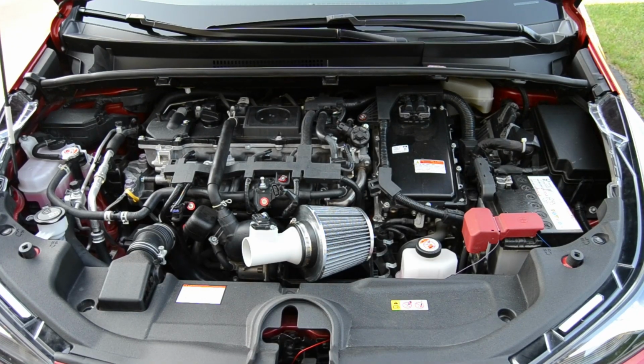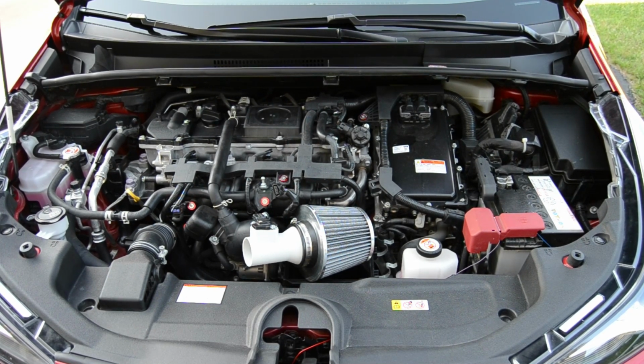Now if you are doing a full-on cold air intake or you're doing a different size of filter, also linked in the description, it's the exact same link, I will have a different version of this MAF sensor mount tube that will be meant to basically just not go into a funnel like this. It'll just be straight, or you could just use this part. But you can run the mass airflow sensor pipe into tubing, which then goes to the filter.